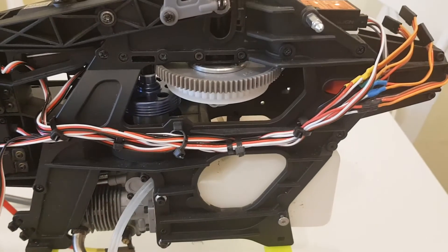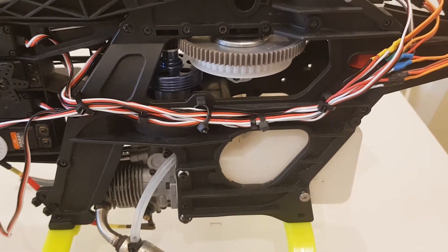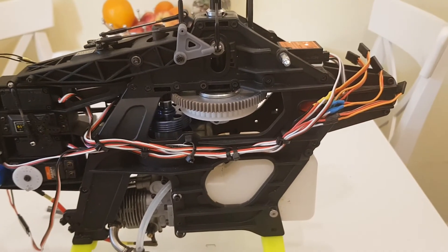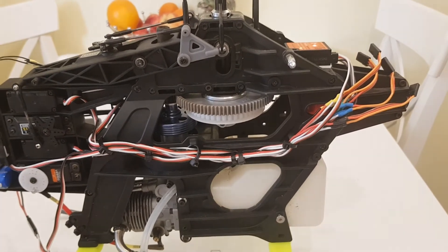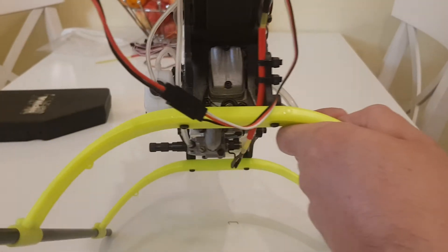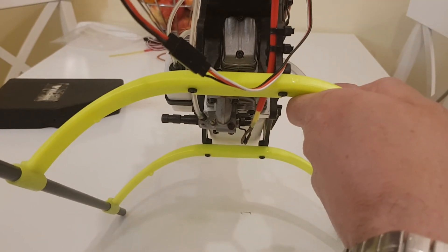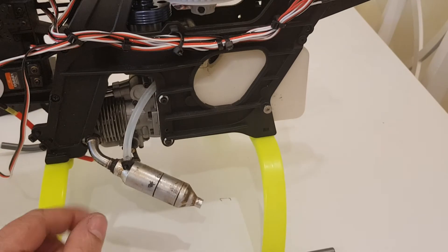So I'm going to try it on the normal gear ratio of the Raptor 50 — main gear and pinion original. Follow the videos to see how it goes. I'm also waiting for a remote glow, since the glow plug ended up in a place where I cannot fit a glow igniter, so I've bought a remote glow.